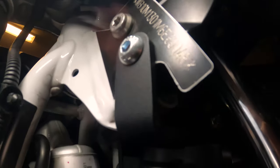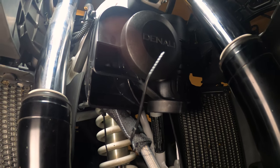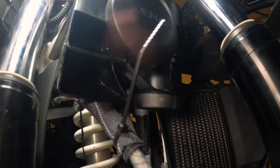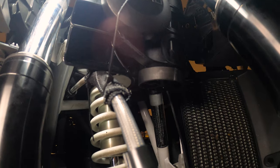I've got the sleeve on there and the lower nut torqued down. I recommend tightening the nut on the horn and horn mount before putting the horn up on the bike — it's very difficult to tighten when it's already mounted. Put the mount perpendicular on the horn itself for maximum clearance on the forks. When tightening down, make sure the horn is pushed back as far as it'll go for plenty of clearance. The only thing left is to hook up the harness from the CANSmart to the horn, run that wire back, and then we'll take a look at the light mount next.